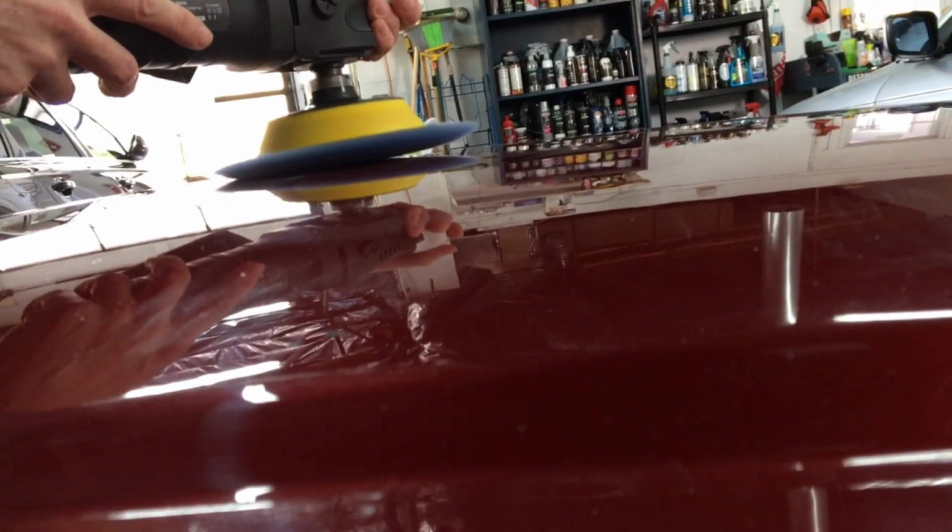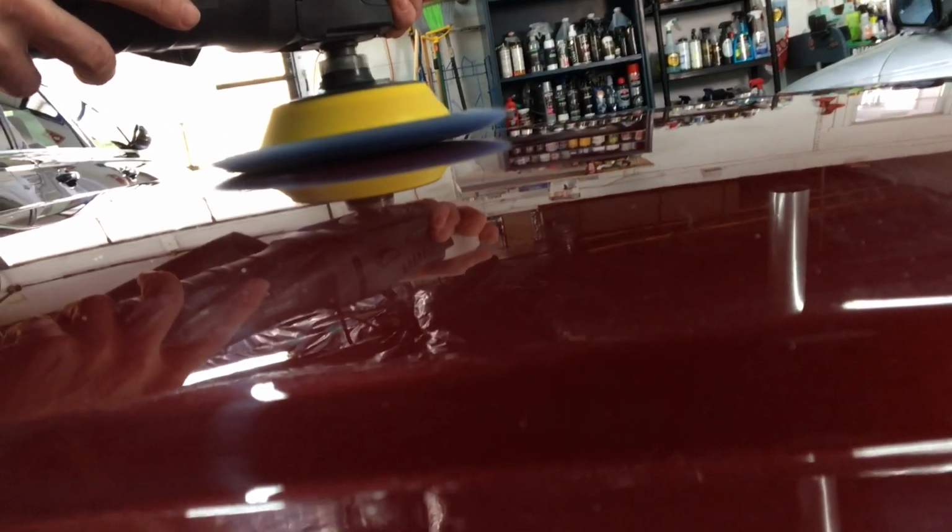When the temperatures spike, there's a lot of flexing going on between the 3 layers of the primer, base coat, and clear coat, and that's where you want to avoid failure.